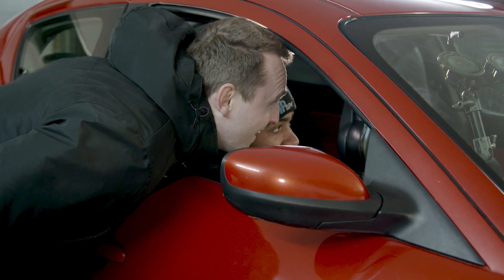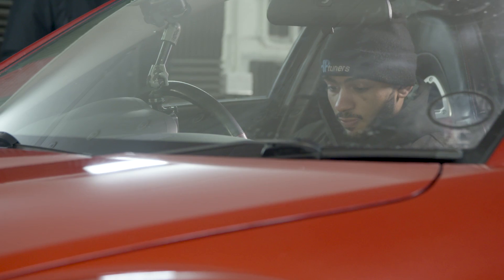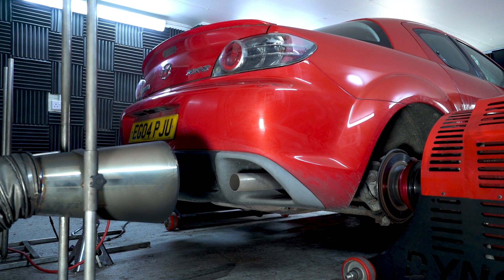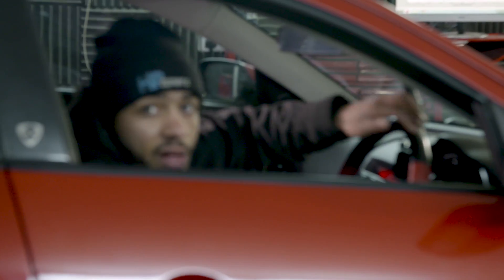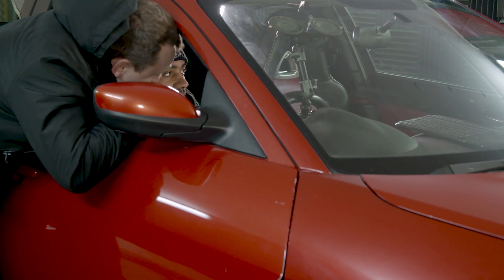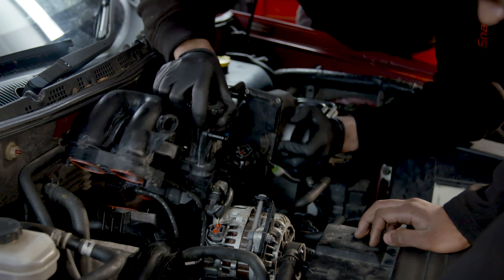It's making more than it was last time at 5,000 RPM and there's still 3,000 RPM left. As Dee starts to open the taps, with Felix successfully starting to produce flames, progress was quickly halted because something wasn't right. It's wanting a lot of fuel at the top and the AFR is starting to lean out as we go further up. Maybe a fuel pump issue.